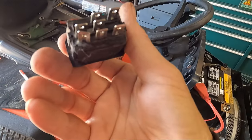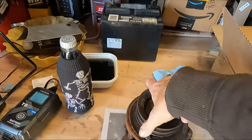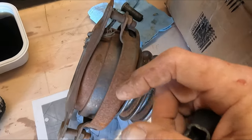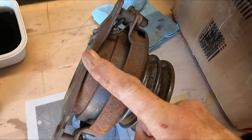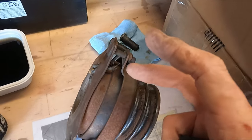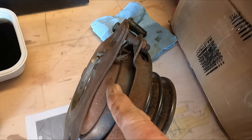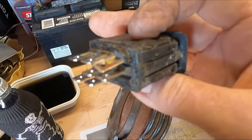What happens with these clutch switches when they wear down — it's an electromagnet. When it makes connection, if it's not properly adjusted, when you disconnect it, it will rub on the copper winding epoxy until it wears through that epoxy. Once it wears through that epoxy, it heats up and often times will melt your switch.